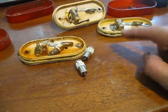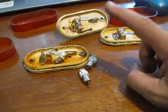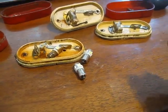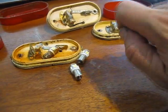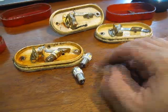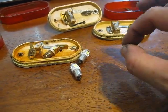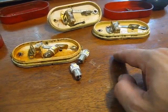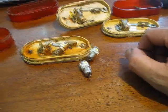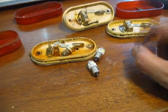around the screw. And I've got to remind you, don't screw it around too tight, because the one I put up top worked the first time I put it in, then it stopped working. Why? Because the screw literally stripped the wire right out of the cable and snapped it. So I had to back it out, pull the fixture off, loosely string it together, and then let the screw draw it in without snapping it with too much tension. And now it works fine. So lesson learned there. Got to be a little careful.